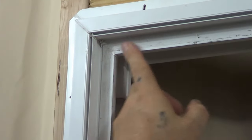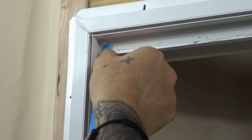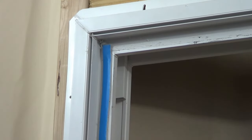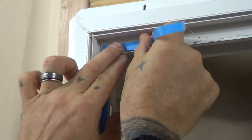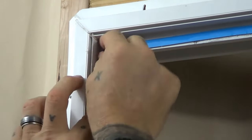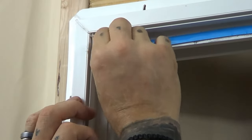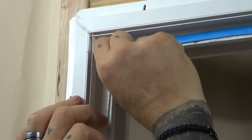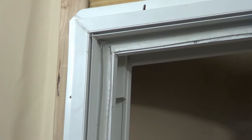So we've cleaned up this edge really well where the window pane fits in new. Now we're going to go to our double-sided sealant and put that right inside of that seal, like here. We're going to put that right inside of here and do this all the way around that window. We're not going to overlap these — we're going to butt right up as close as we can. We're going to put our sealant all the way around the window. Then we've got to pull that little sticky backing piece off — we have to do this without gloves. Sometimes a bit of a pain to get that off, but it'll come eventually. It's really tacky, which is great for the window. We'll pull these off and move on.